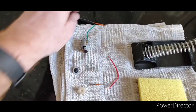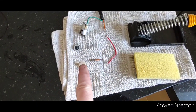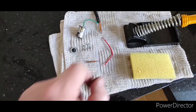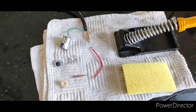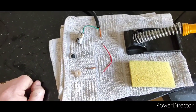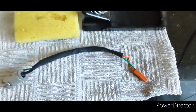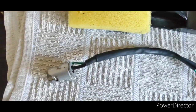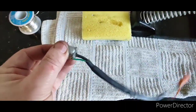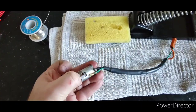What I'm going to do is solder this connection to this piece of wire, extend it, and join this piece of wire to this connection. Before I connect that up, I'm going to feed it through the plastic connector, through the spring, and then back through the bottom, and then finally connect those two up. I'm not going to show you me soldering because I am absolutely pants at it. That said, it's repaired — put some heat shrink around it all, and this is all wired in, springs back in place, push back in, and put the bulb in.